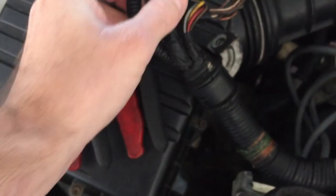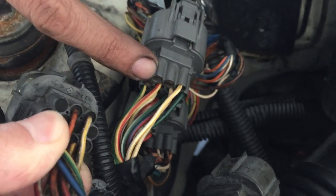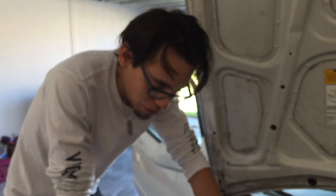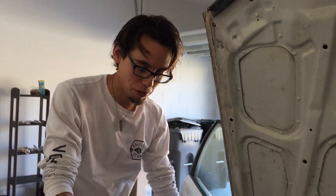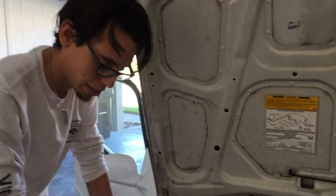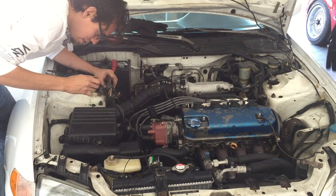That's why we came up with the idea that maybe this harness is from a different EG model — it's the wrong one for the O2 and for this motor. The orange and black cable that you can see here is actually from the O2, and it was giving us a lot of issues. Now we're going to have a matching connection right from the ECU to the computer. But on the original harness, the O2 sensor cables were plugged off because it was a one-wire O2 sensor — Honda didn't require them for whatever model that harness came off of.